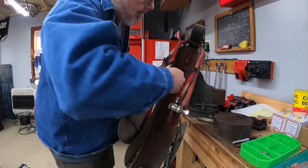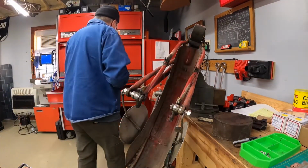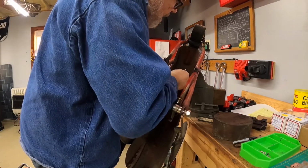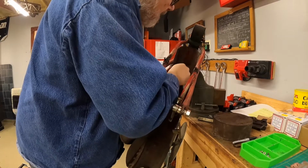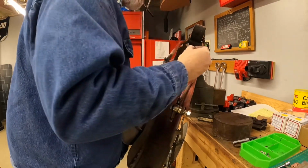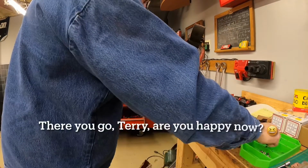That'll be 5/16, huh? No? There's a nice long extension, little bitty ratchet, 3/8 socket. And just take those loose. Now this bike was mostly disassembled when I got it, but the first time I took this fender off, there were some spring washers under these nuts, and that's not correct. I believe they just had a flat washer or no washer at all originally. All right, fender's off.